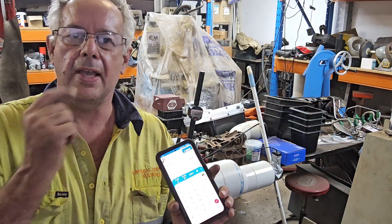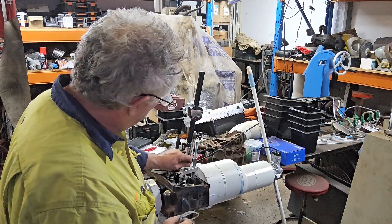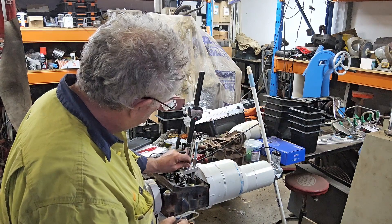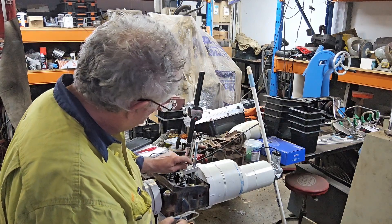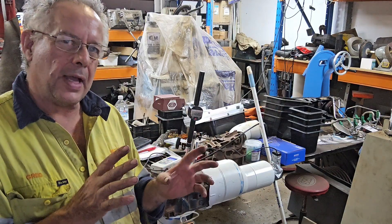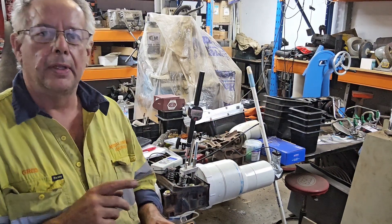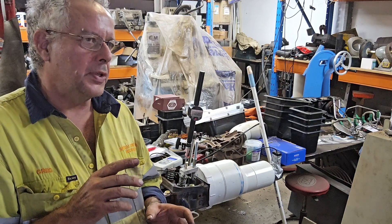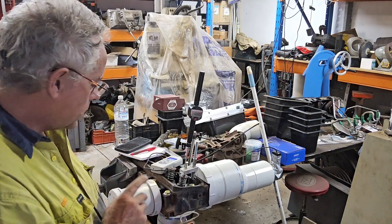You're within 3 CFM corrected on a bench that owes you what - it's a cheap bench that's producing meaningful numbers. So we can now drop this back to 500 lift. We're still in the port flow curve, although the intake valve will possibly be starting to affect it. On the Cleveland, because of the size of the intake valve, 0.25D is about 430 lift by memory, so we could be seeing some influence.